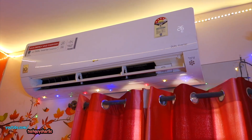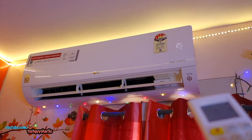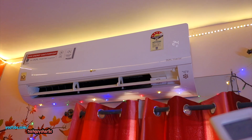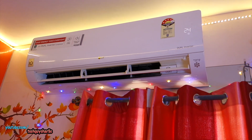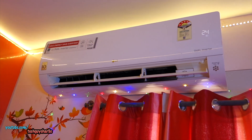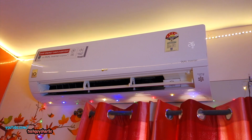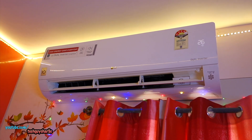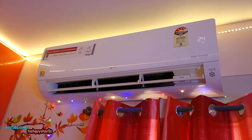These power-saving settings are for peak summer days when the outside temperature is around 44–45 degrees Celsius. During monsoon season, the outside temperature isn't as high but humidity is extreme. During monsoons, lower the temperature to around 24–25 degrees Celsius and slow the fan down to around speed one or two. In this 150 square-foot room, this setting during monsoon season is extremely good — it pulls out all the moisture, the room stays cool, and you don't want to keep the temperature too high or the compressor will slow down and the AC won't remove much moisture.